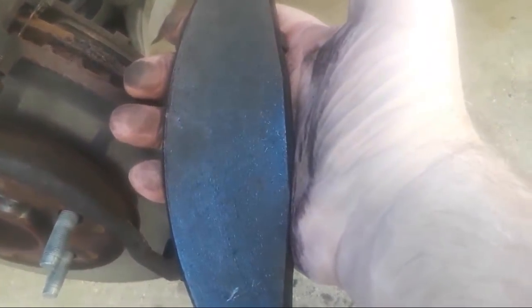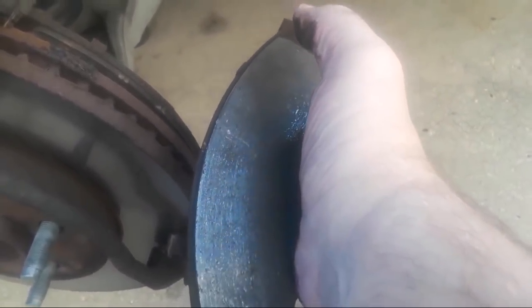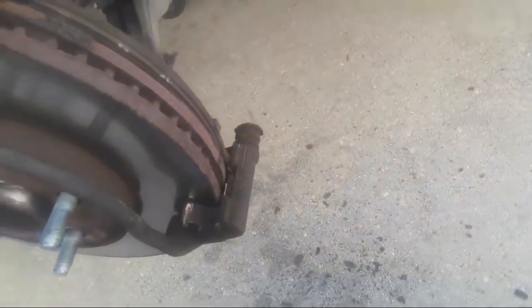There's my outboard pad. This is the friction material — that's the friction side of the brake pad. You can see how thin the lining is there. So we knew we were going to need to replace these. I've already got brake pads ordered — they should be in sometime this week. Next weekend we're going to do a brake job. Today we're just doing a brake inspection.